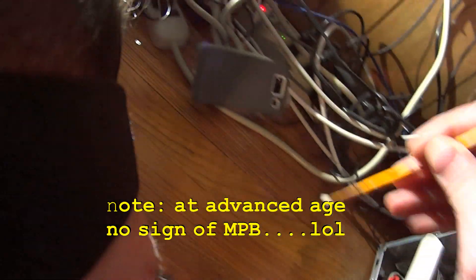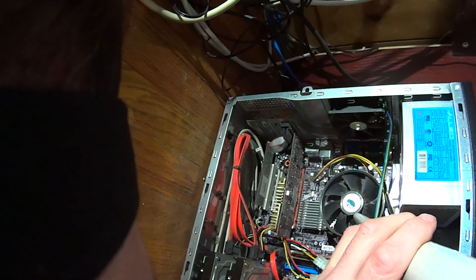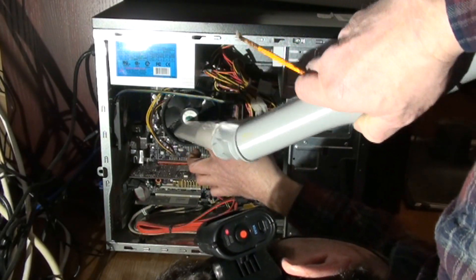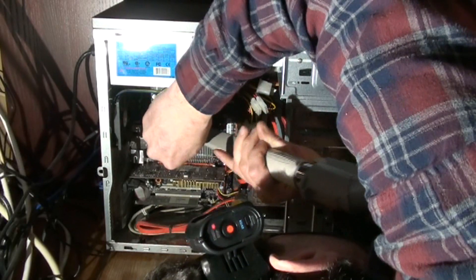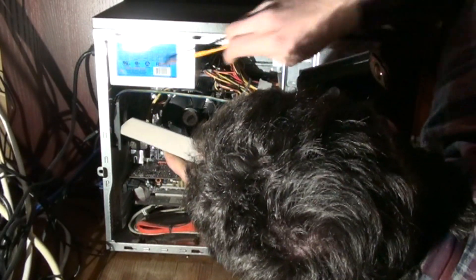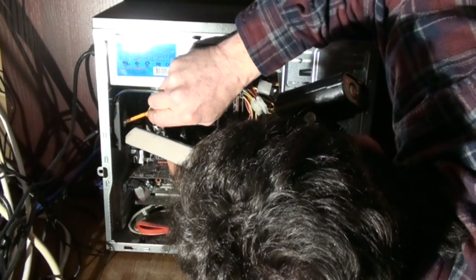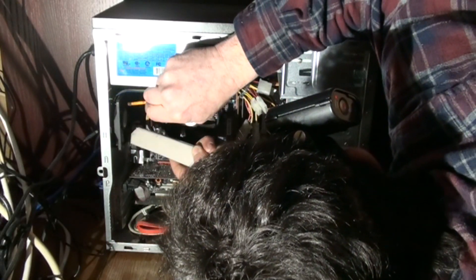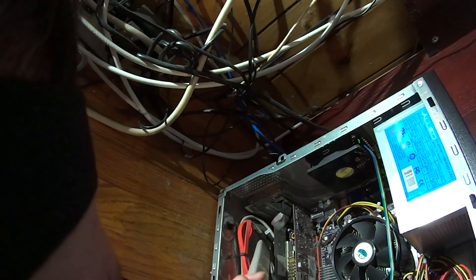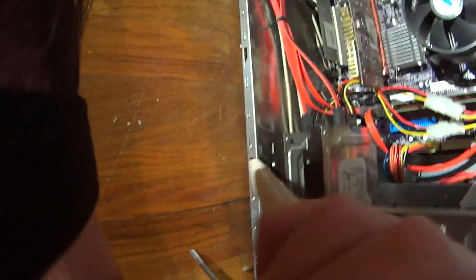I didn't mention it in the tools needed, but if you have a small artist paintbrush it would help you get into the fan and loosen up some of the dust as you rake across the heat sink, so the vacuum can suck it up. Then we move to the back fan and the rear case fan, and as we're back here we're going to get close to the video card and the floor of the machine and any other cards you may have — try to get close but again not touching, getting all the dust you can.